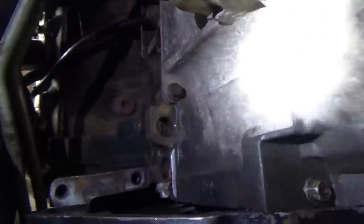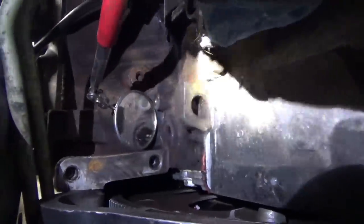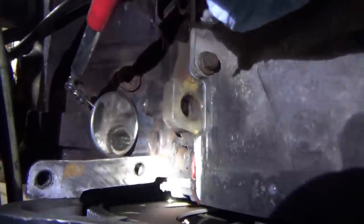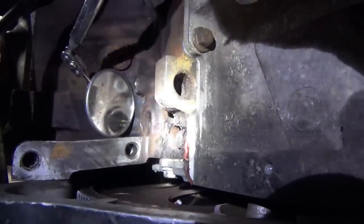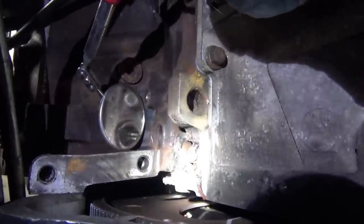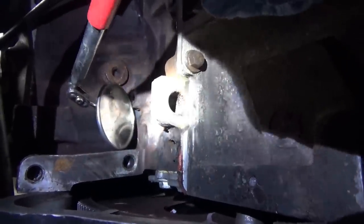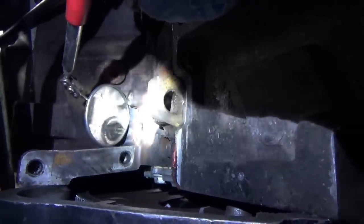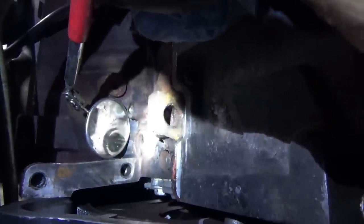There we go. There's no way that is going to fit in the rusty hole — they definitely jammed it in. Let me clean this stuff out and see if we can insert it a little further in. We might have another variable here. I stuck my finger in the hole just to see if I could feel the teeth of the reluctor. This is the weirdest thing — the reluctor almost looks like a two-piece, almost like clutch discs or something. That doesn't make any sense. The teeth are not aligned.